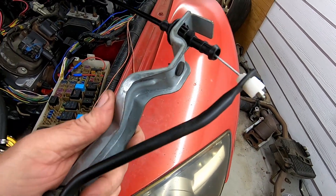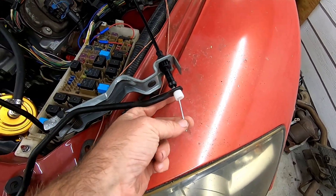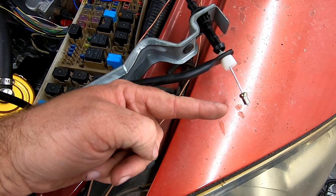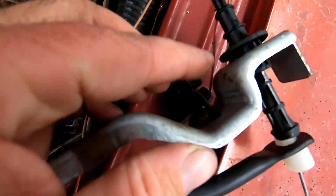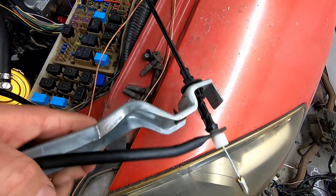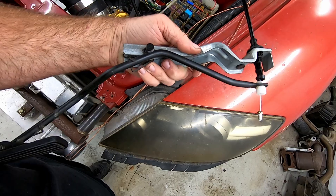Got it together and you can see the articulation. It's just not good enough because the idle spot is right there — that is taut on the throttle cable. I need to essentially either bend this part over to where that is and create a new stop when it's fully compacted, or take the little rubber grommet off and maybe put a bolt there or weld a stud to it. I'll figure it out. That's the plan to get the throttle cable completely working. It does move the throttle just fine, but there is a lot of slack in it.